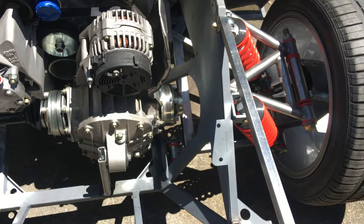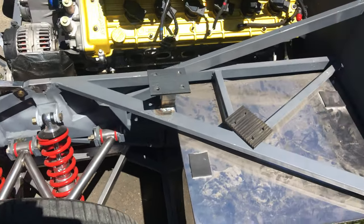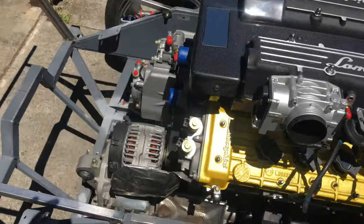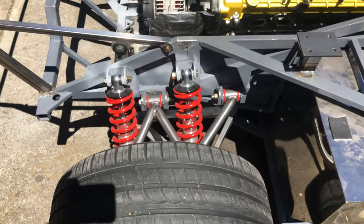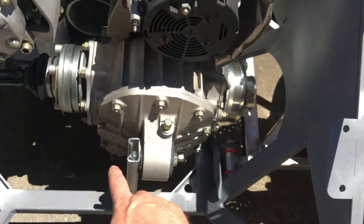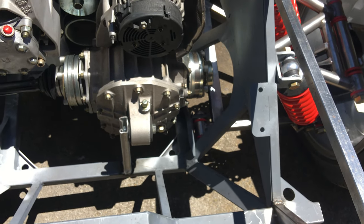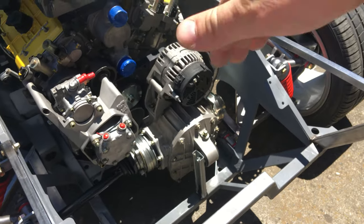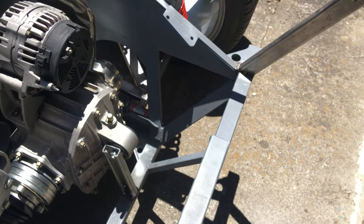That might have issues going forward — I don't know yet. But as far as front to back, the engine is one inch off the firewall and my rear diff lines up perfect with my hubs, so that's good. I have a temporary rear diff mount; I'll make a more OEM-style mount after I get the gearbox in. That'll pitch forward and up and down, and I'll also do some spacers and shims for alignment.